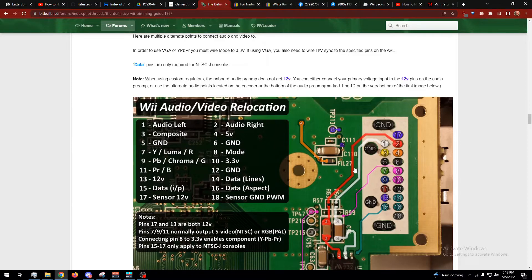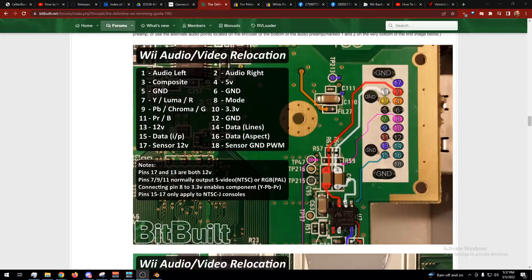For V-sync, since it's a much slower frequency signal I wasn't worried about noise, so I just went straight from the chip up to the right out. If it's not obvious, you cut these traces before you try to do that — it probably wouldn't break anything but it might, so cut the traces and solder those wires. I found room between the controller ports and the memory card ports to put a couple of RCA jacks, then connected ground to this tab here.